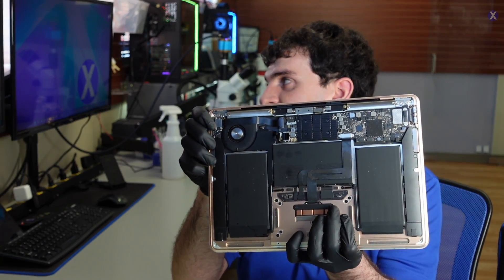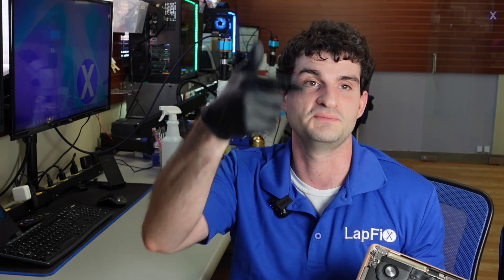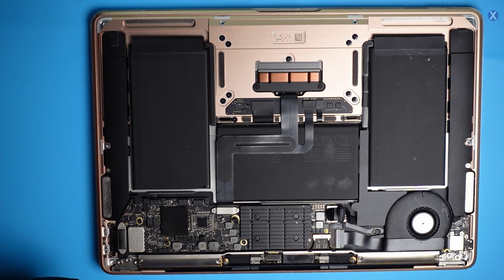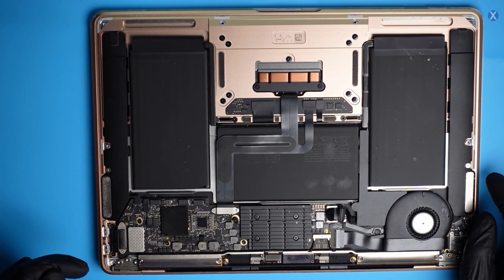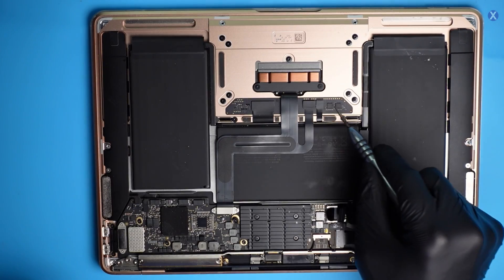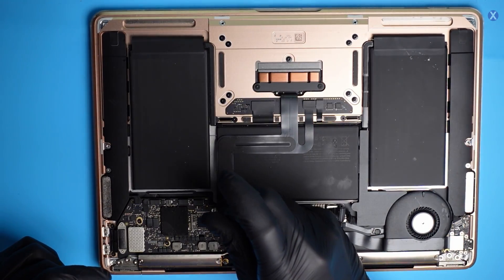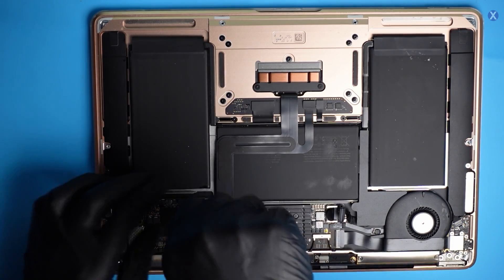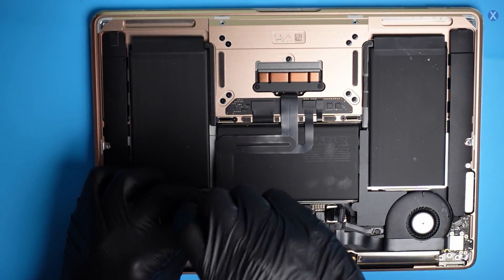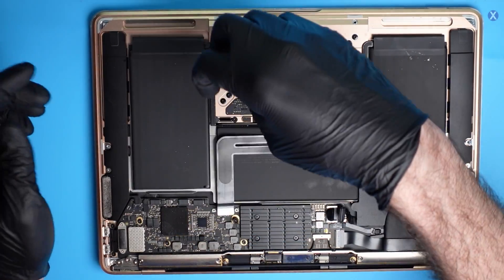We open up and we see the MacBook. Do we see any obvious corrosion? We see some stains everywhere. This little board connects the trackpad and keyboard back to the main board — usually when you have a problem here, you have a problem everywhere. So let's remove this connection to check, because we don't want to plug it in when we know there's probably liquid on the keyboard.